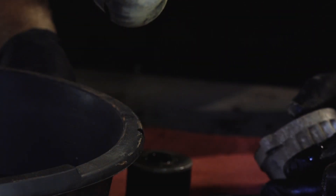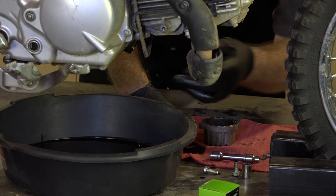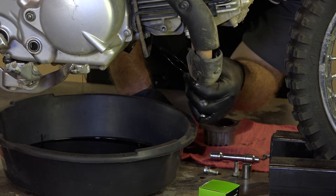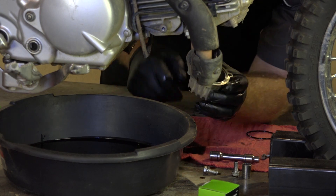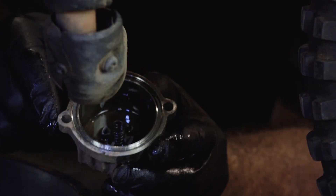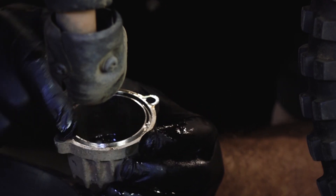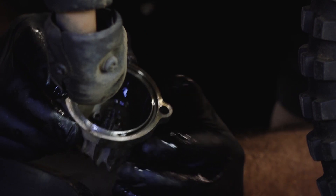Alright, the other thing we need to keep up with — and it actually stayed on the engine casing — is the O-ring for the housing. See that right there? So we need to make sure that goes in. When this housing came off, there's a little bit of dirt on the edge and some of that actually fell in to the inside of this, so we need to get that cleaned back out before I put it back together.